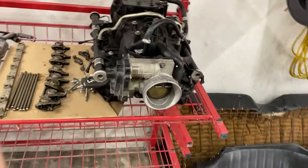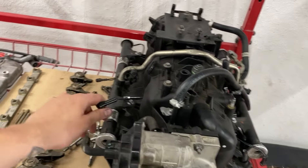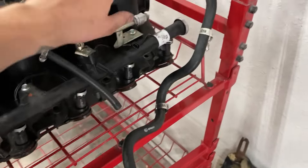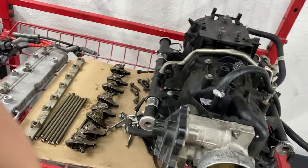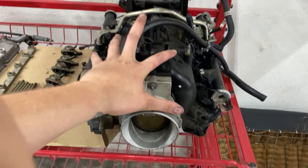The order of operations for taking a head gasket off can vary. I decided to start by disconnecting the battery, undoing the air intake, and then I really focused on everything on the intake side of things. I unplugged all of the injectors, all of the different connectors, undid all of the vacuum hoses front and back, disconnected fuel, took the air intake off, and then was able to get to all of the bolts that go into the head, and then that popped off.